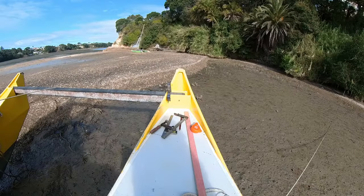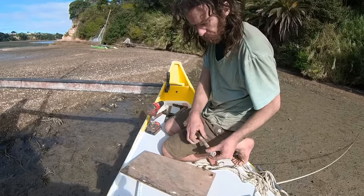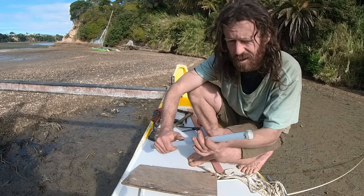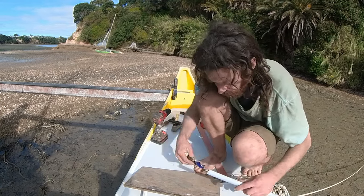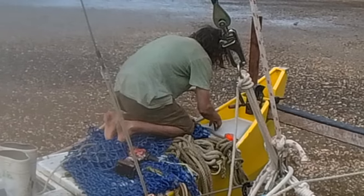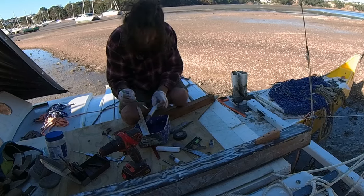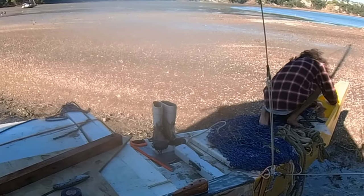Finally it was time to put the crossbeam back in the boat. The old crossbeams had a hole with a liner — I think that's a very good idea because otherwise rot spreads. A metal liner isn't that great, so I'm going to use plastic conduit, which fits just perfectly. The hole was drilled at 16mm but needs to go to 20mm. I did a practice run — I was able to drill the 16mm and then drill the 20mm over it. I set up the beam in a drilling guide and drilled all the way through in one go, ensuring the hole in the trough walls and the beam are all in line without actually measuring everything. I coated the linings and holes with epoxy and inserted the linings, and did the same with the linings going through the troughs — though if I was doing this again I would just have one long piece and cut it afterwards.